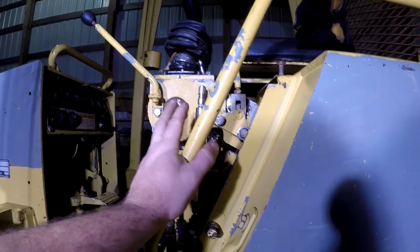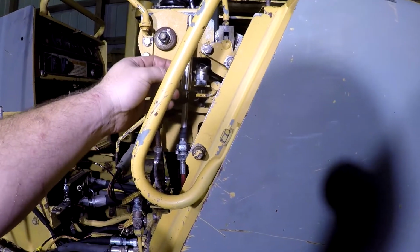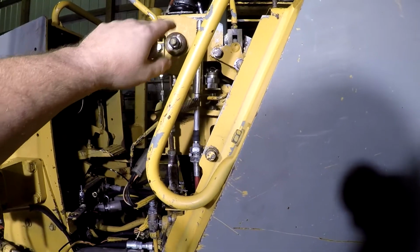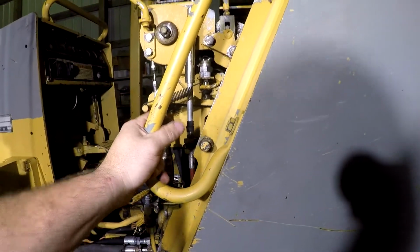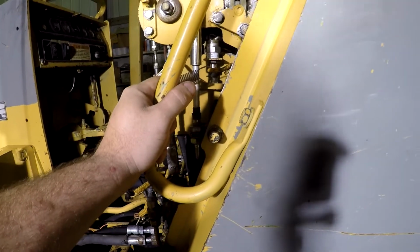and I think that's why whenever I touch the joystick, it's got a little pressure behind it, and so you're not getting enough current to fully operate the solenoid. But then when you start messing with this, it changes the pressure and maybe it helps it, and then sometimes it'll just work, sometimes it won't. You can let it sit there and it'll eventually pull the solenoid and it'll work.